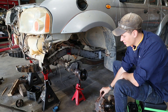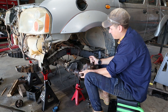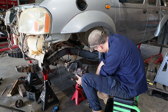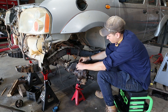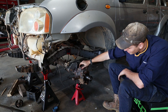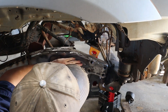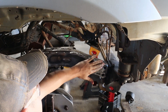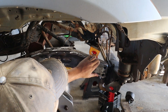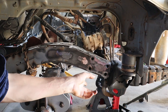We're going to chuck our steering knuckle back on the passenger side so we can attach our links to it. With the steering knuckle on, we go back over the other side to attach our steering box. I'm just going to grind flat anything that could be in our way — any welds that are a little bit proud and anything that's sharp — so any welds that left a rough edge we're just going to clean up. No one likes getting cut when they're working on stuff.